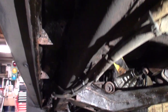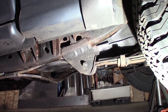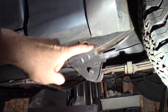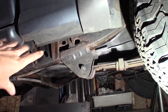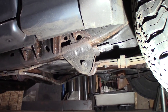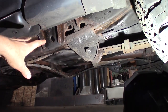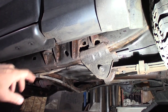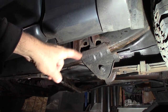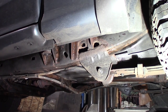This is slimy because it's got Fluid Film on it now. But you can see how all along these seams — on the cross members, on the frame — all those welded seams are rusted. That's because Z-Bart seals all those seams from the inside and doesn't allow any salt to get out. It rots the thing terrible from the inside out, gets all over the connectors. You can see it on the gas tank skid plate. It's completely destroyed the frame where the rest of the truck is mint condition. So this is preservation, not restoration — we're going to cut some rust out of this frame rail, make some plates, and weld it back up.